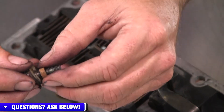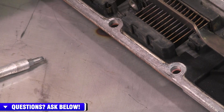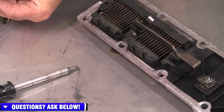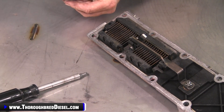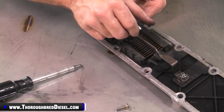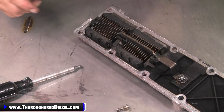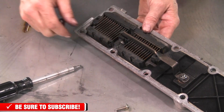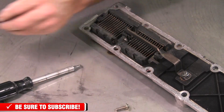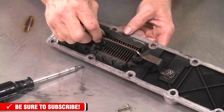There's a little insulating washer that keeps you from having a power transfer that goes to the intake plate itself, so you want to set that aside — you're going to be keeping it. Then you just need one of the steel washers from the plate. The stock bolt we won't be retaining. We will not be retaining the stock nut either, because that is not used since we're using a threaded bus bar. So one washer, then that thermal insert, is all you need from the bus bar.